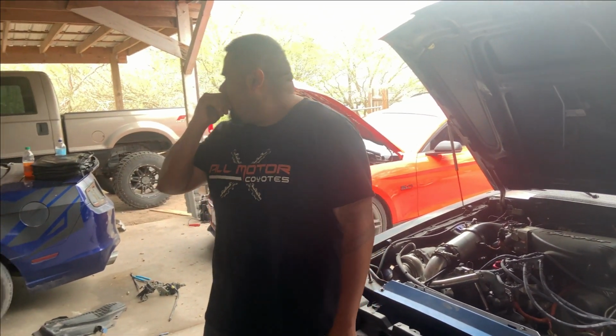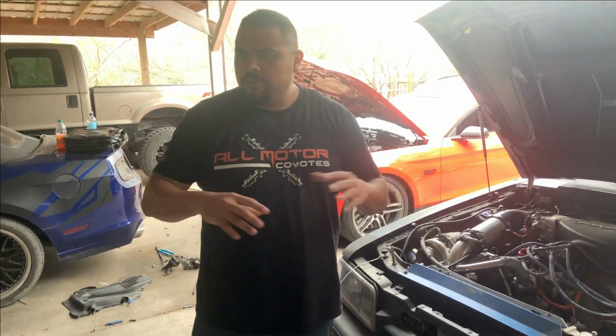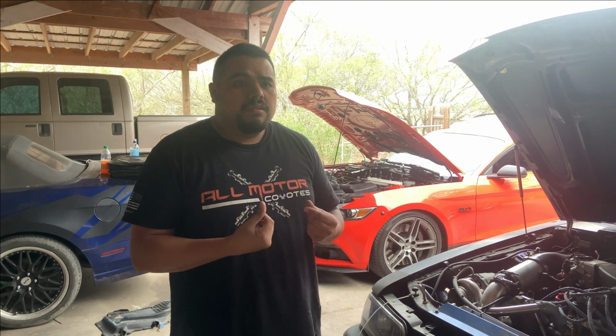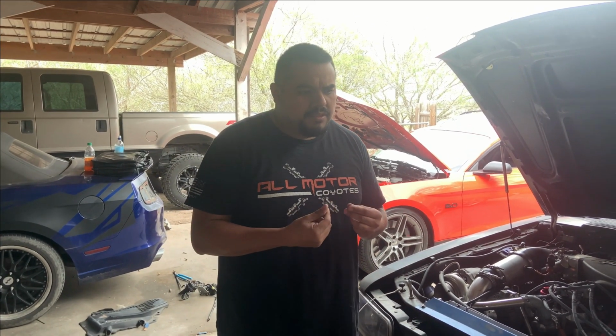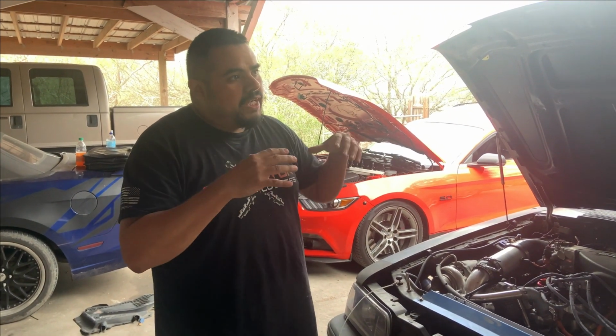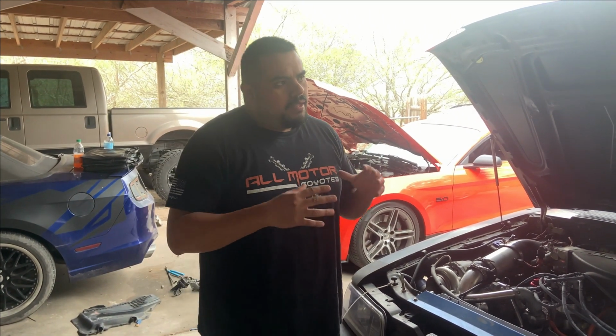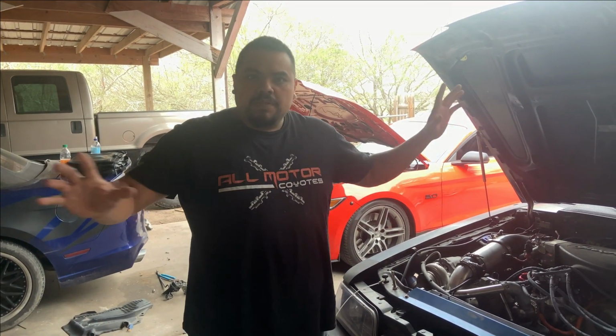Yeah. On Mark's car, where's this car at? Yeah, he left. Okay. On Mark's car, we installed the Roush blower, we installed everything, and we were on the dyno. And even if you're on the loaded dyno, it's very, very hard to feel the spark blowout. It's very, very hard because you're in a controlled area, the rollers are moving. You can't actually feel the car shaking because it's not going anywhere, it's stationary. Yeah. So we couldn't really feel spark blowout until we went wide open throttle. Once we went wide open throttle, the whole thing just misfired like crazy.